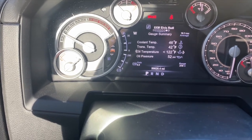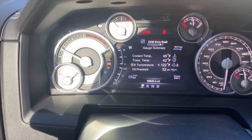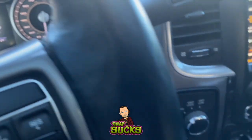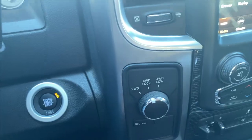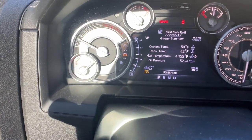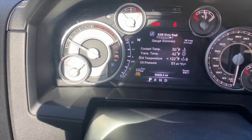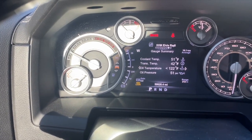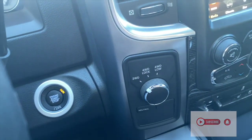So you can see we've got a whopping 50,828 miles on this thing, and like I said the four-wheel drive is not working. Come down here to four-wheel drive — you can see it starts blinking. Everything looks good, four-wheel drive lock is lit up and not blinking, but the actuator is not actuating. Go back to two-wheel drive.